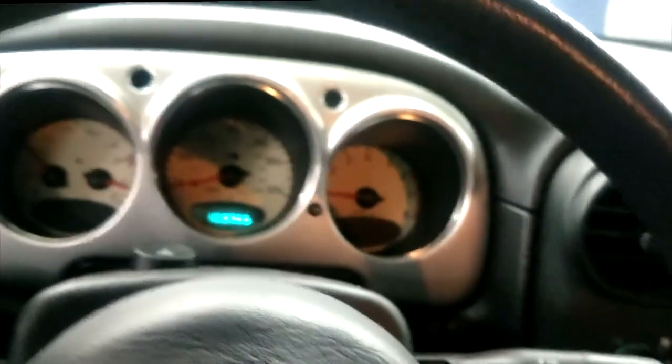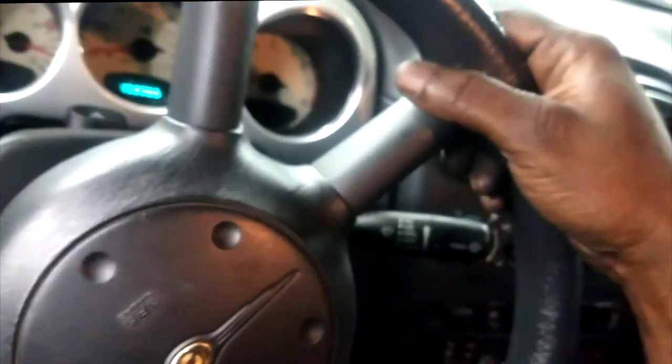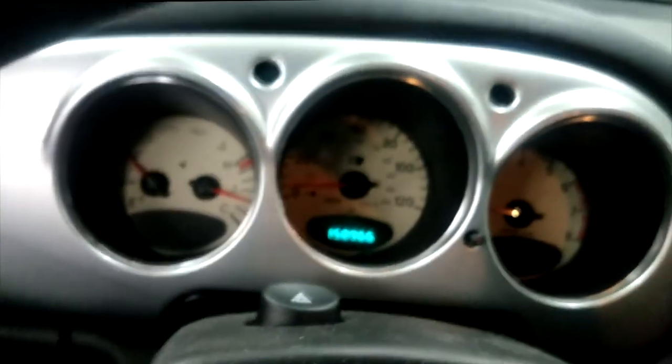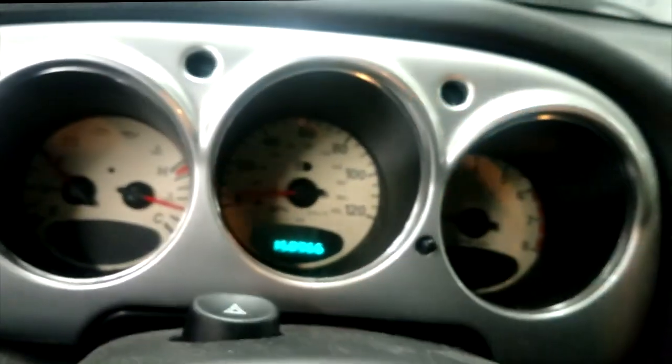We're going to reverse. Okay, enough is enough. Make sure speedometer operation is set. I'm still in the shop, so once we pick up some speed, the speedometer should move. Because before, it wouldn't even budge. That's because it hadn't gotten a hold of the pinion factor yet. Okay, look at that. Y'all see that speedometer moving? Yes. Guys, we have fixed the problem. I mean, I'm only going slow right now, but the problem is fixed. I now have speedo operation.